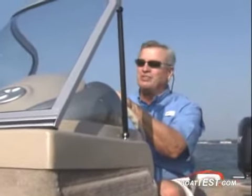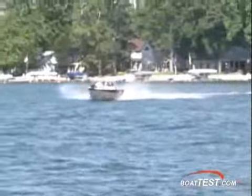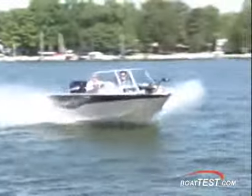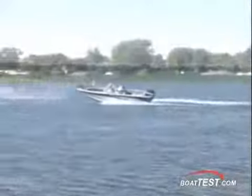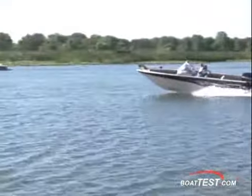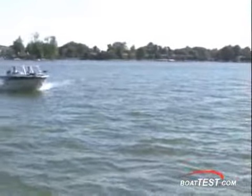Now that we've done our walkthrough, it's time for the fun part of my day — let's take her out and see how well she performs. Testing on a challenging windy day on an inland lake, I found the 182 Pro Mag amazingly quiet riding with little slip in turns and no blowouts or cavitation when turning. Near top end, you still get a boost when you pour on the throttle, and maneuvering around the docks was also easy. She was on plane in a quick 2.3 seconds, passing 30 miles per hour at 6.2 seconds. The 182 reached a top speed of 49 miles per hour at 5,500 RPM, and the best cruise speed at 3,000 RPM going 25.1 miles per hour for a range of 124 miles.